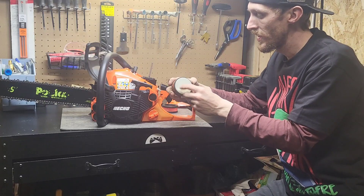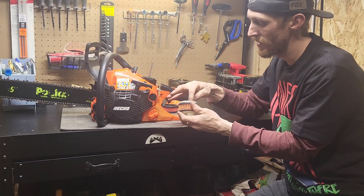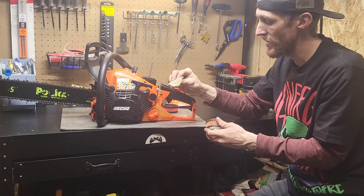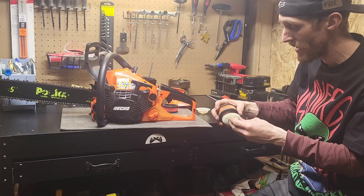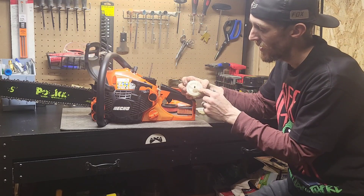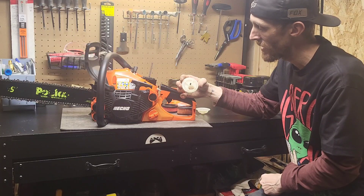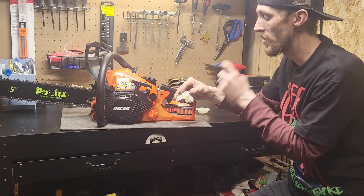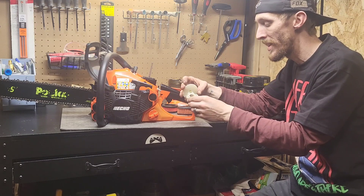I've done some modifications on the horn. Here's the OEM 490 setup — you can see it kind of works about the same way, give or take, but this is shaped for the 400, not the 490. You can see how the 400 horn gets that same little kidney bean shape. I notched this one out — it's going to wind up going on one of the Poulan 4620, 315, or 295 type saws.